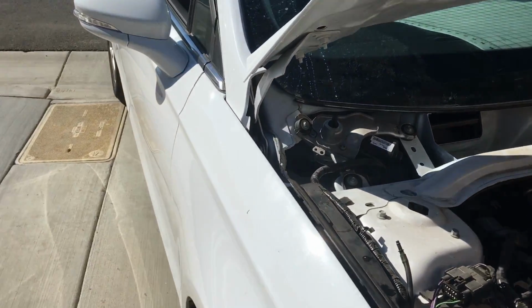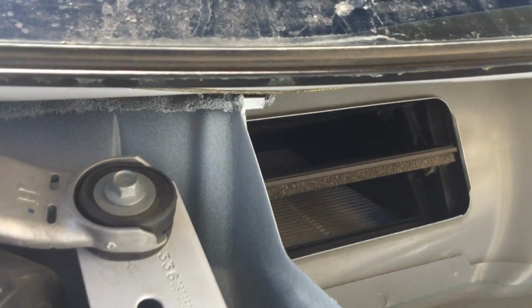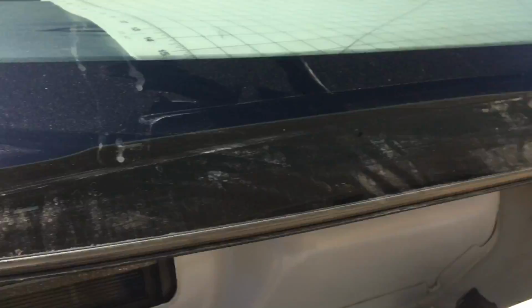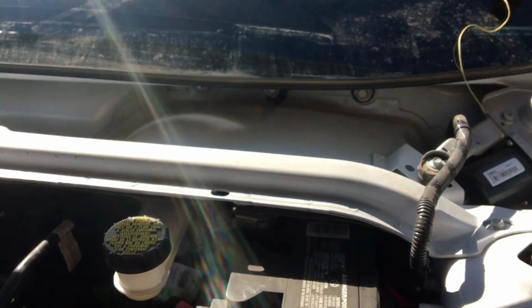Alright guys, so I just wound up my fiber line all the way around the glass, and this is the mistake. See, I checked before, and it does happen very often. From the outside, you would think your fiber line's tucked in right between the glass and the pinch weld. Look at here though. It unfortunately went under on the bottom, under the firewall, under the pinch weld. And now I could start cutting into the pinch weld, and that's very, very unsafe.